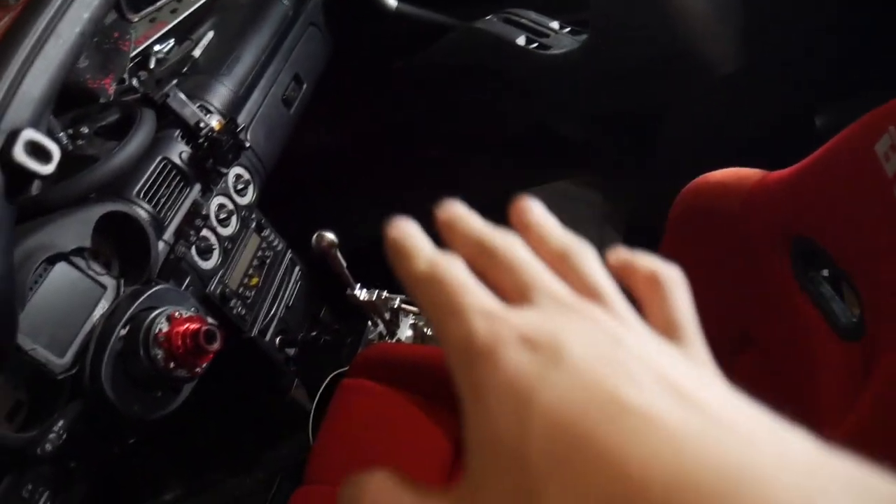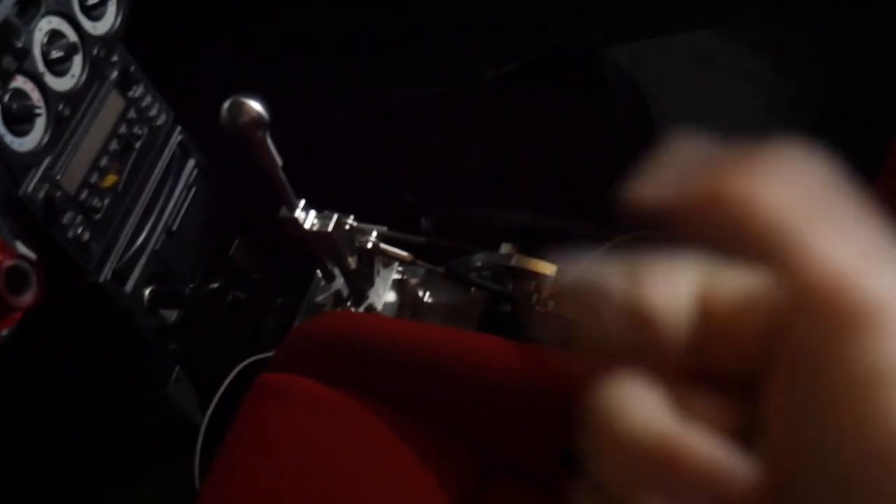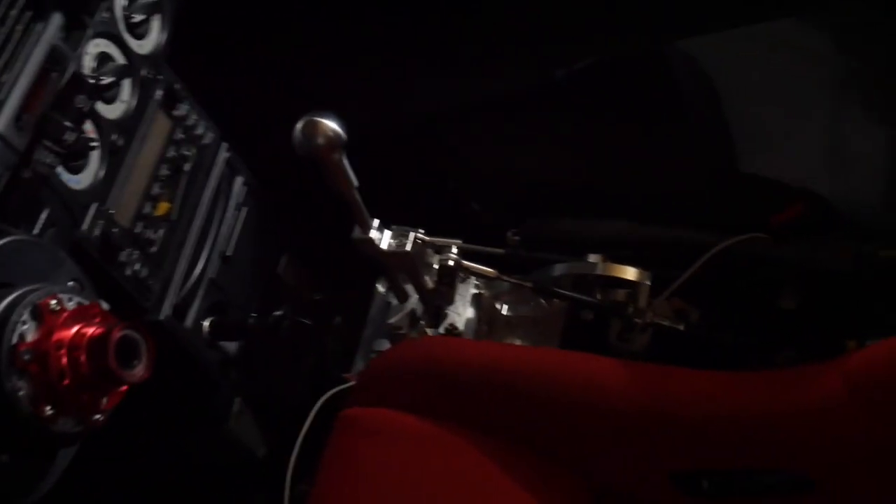K-Tuned billet shifter stops. I installed them already — they're really easy. It comes with four Allen screws as well as a shifter stop. It's those actual bars right here, and basically they limit the shifter from going any further. If you guys look, it actually limits the shifter from going too far, so you don't tear any cables. I was at autocross with my stock shifter and it actually pulled the cable so far out that it ripped it out because of the short shifter. So I went ahead and installed those shifter stops. I'll put the link in the description below — it's just a quick add-on. If you guys have this K-Tune shifter, go ahead and add it on.